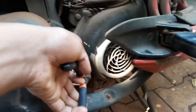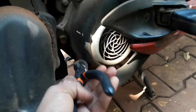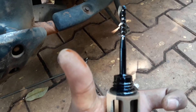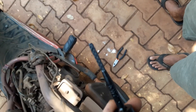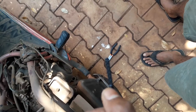After that, we'll see the level of oil present and how to check it. For this you require this tool to open the oil cap. To check the level of oil, rotate this one to remove it. After removing it, it will look somewhat like this — you can see it has some oil particles. Clean it using a cloth. After cleaning, you can see the crisscross sections — the oil level should be up to that mark inside the engine.